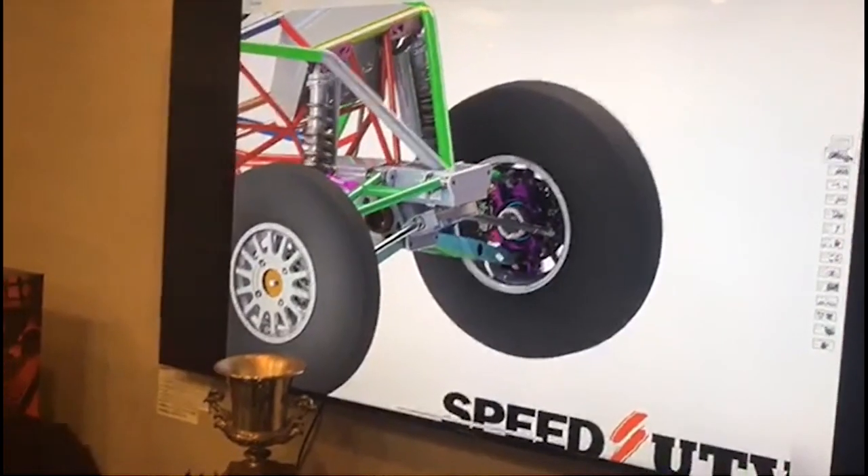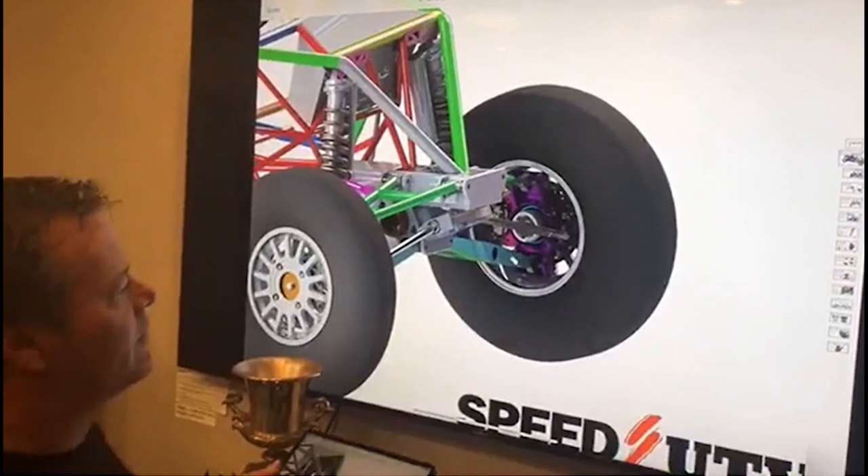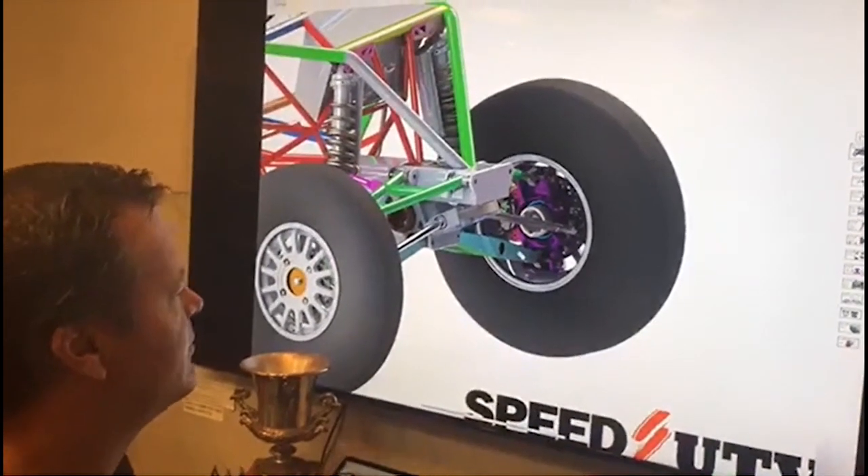As we move into the front suspension, there are no ball joints - I feel a little sad about that because I liked the freeze trick. Ball joint issues aside, we've definitely seen the videos and pictures of cars with the front end laying on the ground. There are also no offset tie rods this time, and there are massive dual-piston brake calipers.